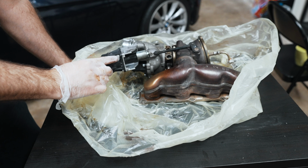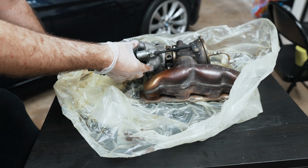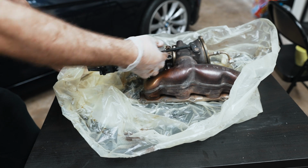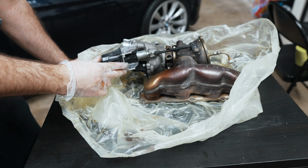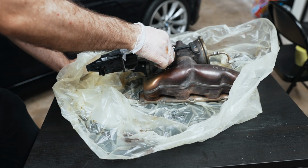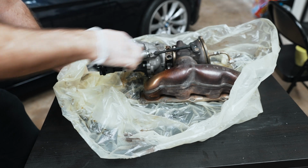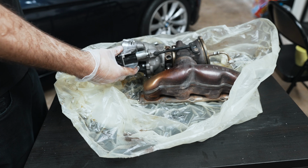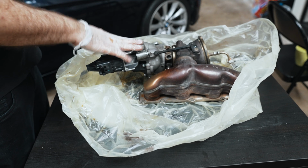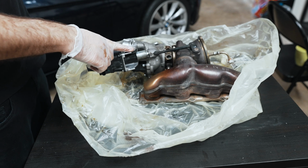If you're familiar with these turbos, you know that this is an electronic wastegate, and my car has a pneumatic wastegate since it's an early car, but I believe we should be able to pop this clip out and move over the whole mechanism with 2 screws to convert it back to a pneumatic, and then we can set the wastegate tension and whatnot, and adjust it accordingly since this one's electronic. It seems to be the same turbo otherwise besides this mechanism and the way it bolts to the turbo. It's modular in that respect. We're going to be replacing this in the next video and tackling the mechanical stuff, and then we'll do the cosmetics exterior wise after that.